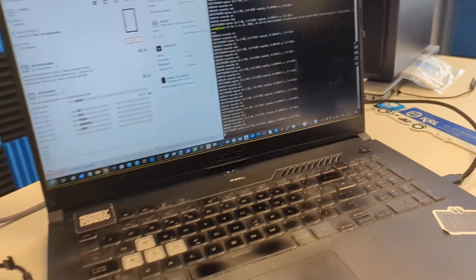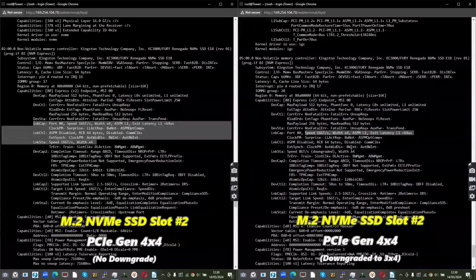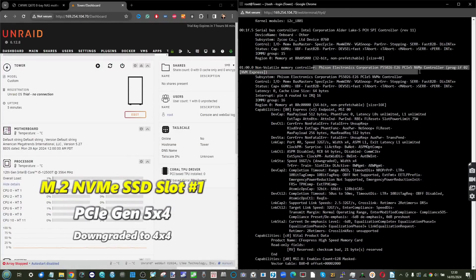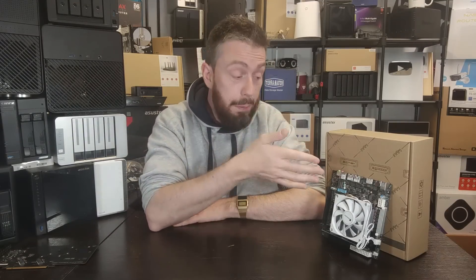It makes measuring power consumption in this review a great deal more difficult. With regards to SSD performance, when we set this up with Unraid on board inside our test machine, we ran tests on all three lanes. By default, even though I utilized a Phison E26 controller on the Gen 5 x4 slot without tinkering, it had been downgraded to Gen 4 x4, meaning performance was still pretty good at 6.2-6.3 gigabytes per second read and write - but still not as good as it would have been at full Gen 5 x4. A lot of that was the CPU I was utilizing, and I could have gone into the BIOS and really opened things up.